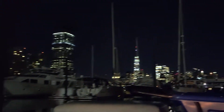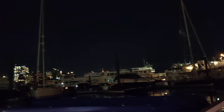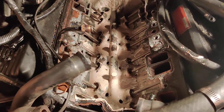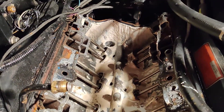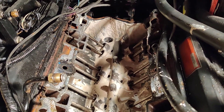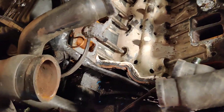Look at that. Too bad we got problems with the engine. It wasn't starting — was hydro-locked. Pulled the dipstick, found it all foamy.